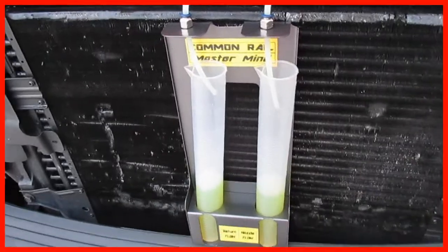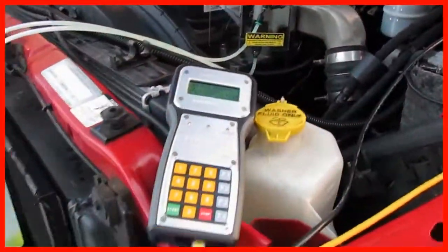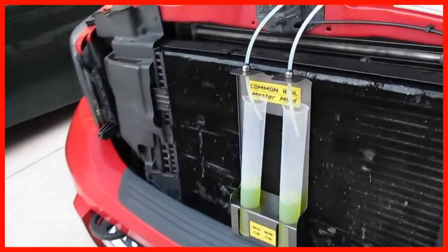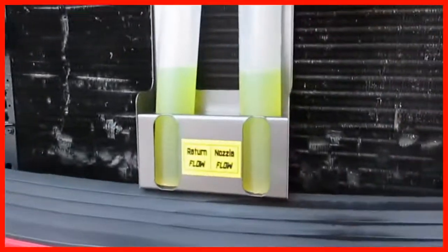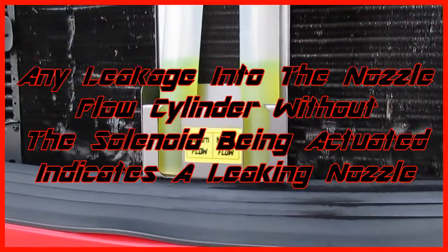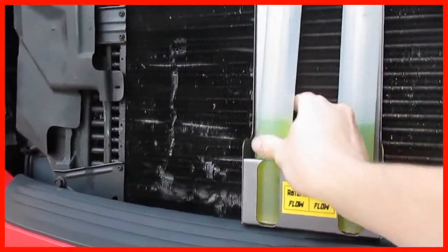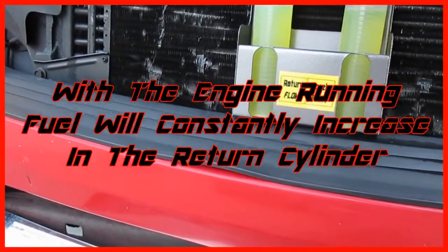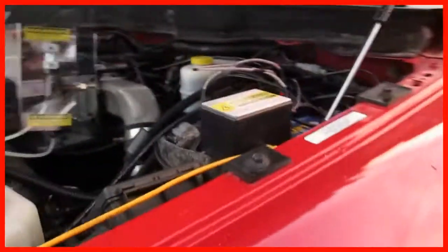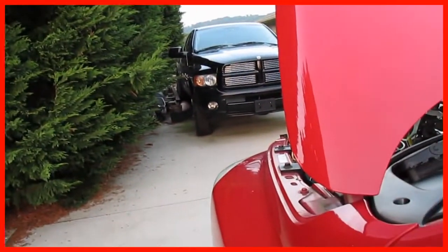We can see what our injected quantity volume is on this side. I'm going to start the truck up and we're going to run a 1600 bar test. Once we get it up and going and get the rail pressure established, we're going to look right now and see — looks like there's about 118 milliliters in here. That's not going to change, but the return is, because anytime the engine is running we're going to have return fuel dripping out of here. Looks like we're at about 122 there. So once we get the engine running, we'll come back and see what the value is in the return and take note of that.